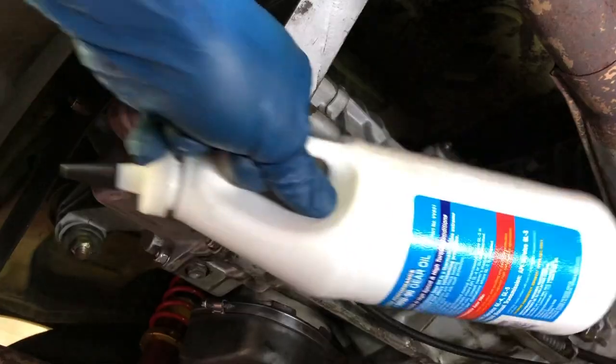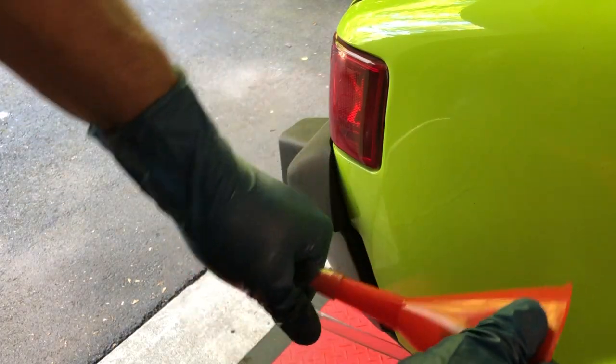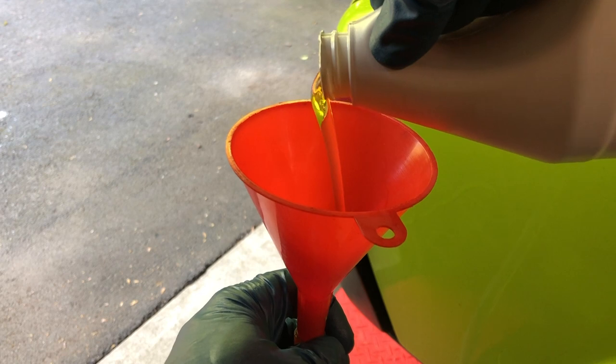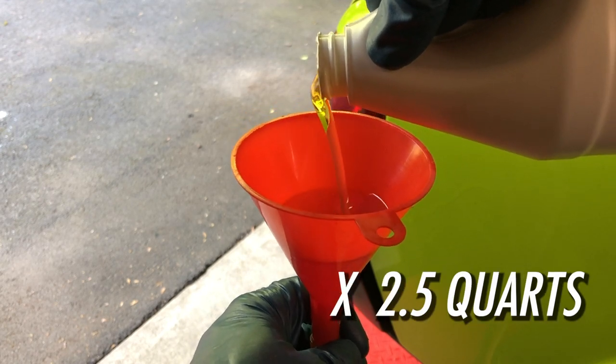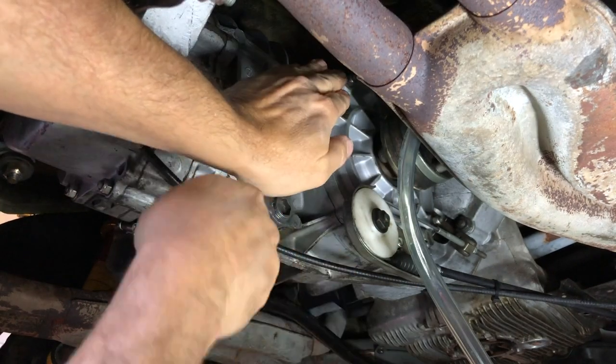Because the fill hole is totally vertical and there isn't much space above it, you can't easily fit a bottle or funnel up there. The easiest method is to get about four feet of half-inch inside diameter tubing, wedge a funnel into one end, and put the other end into the case. Use a clamp on the muffler to hold a little bend in the hose to keep it from popping out. Open all three bottles of oil so they're ready to go beside you so you don't have to put the funnel down and get gear oil all over the floor — ask me how I know. Slowly pour in the new gear oil beer-bong style; it'll take a minute since it's thick. Put two and a half quarts in and check the level with your finger — it should be pretty close to the bottom edge of the fill hole or just weeping out. Put a little anti-seize on the plug and tighten to about 14 foot-pounds. You're done for another 10,000 miles or so and you've stopped the nastiest-smelling drips on your garage floor.